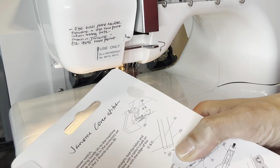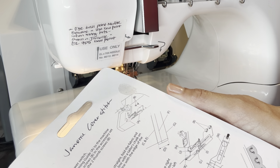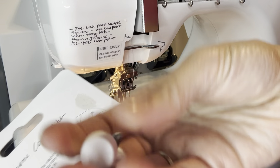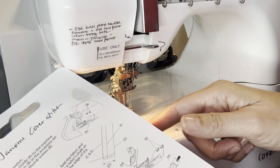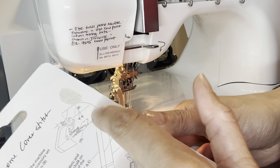Now on the back of these instructions here, it says turn off the power switch, attach the hemming guide to the machine, attach two thumb screws in the accessory set — that is the little box that your machine came with. Tighten the two thumb screws firmly in B.